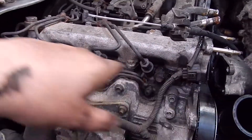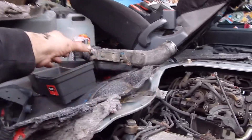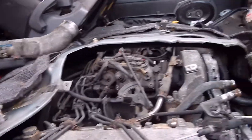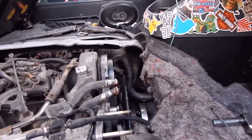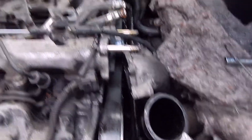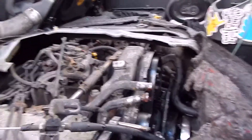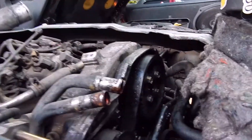I've removed this intake piece here. I've removed the throttle body which is mint because it's absolutely disgusting, so I'm going to clean that. I did undo the two water hoses - had no choice in the end. The metal hoses that come across here, I had to disconnect the rubber ones from the end. I think they're breathers for something, I'm not entirely sure. I've disconnected the throttle cable as well.